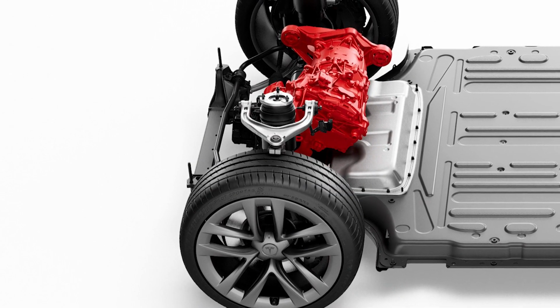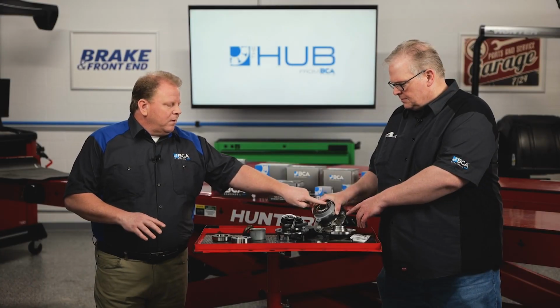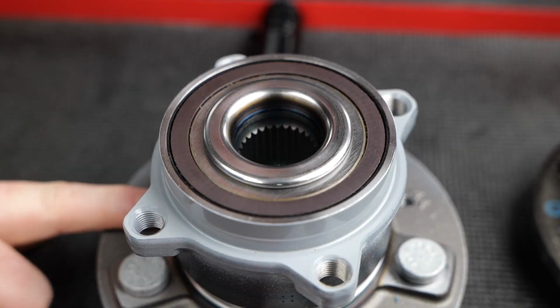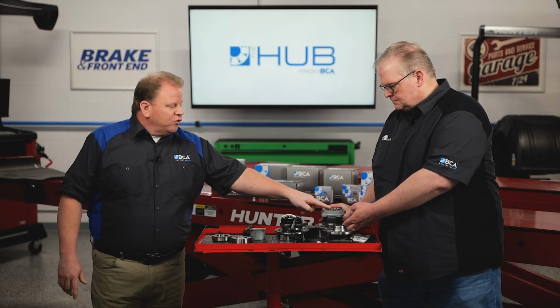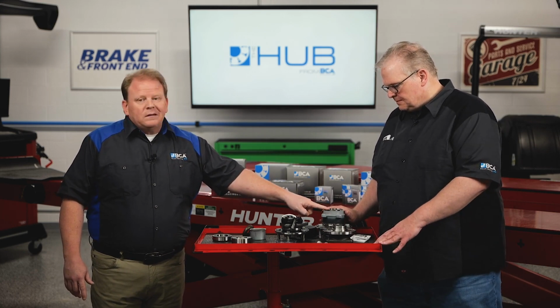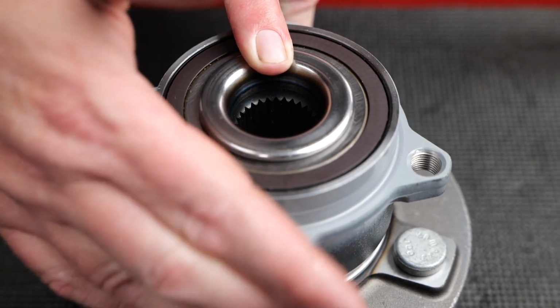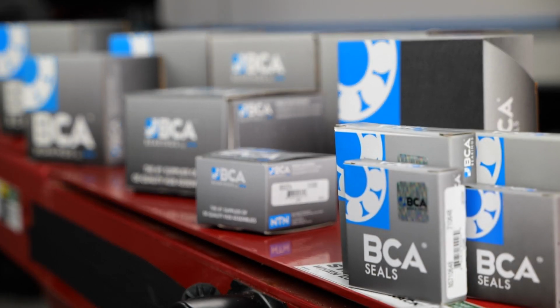But the difference in design on the Teslas is you're going to have a rolled closure, or orbitally closed design. If you see here, this is the part of the inner ring that is going to be rolled over, capturing it and applying preload to the bearing assembly. It reduces the possibility of premature wear if you don't get the torque spec correct. It ensures longer life, lower warranties. Currently, we've got about 400 part numbers in our line that are orbitally or rolled closed design, and we continue to add more as we release product moving forward.